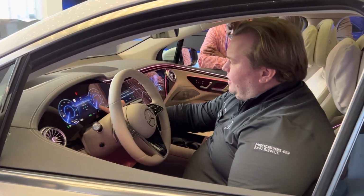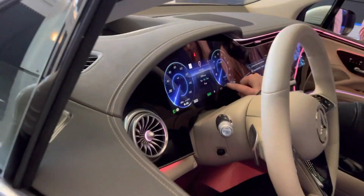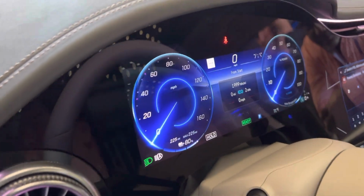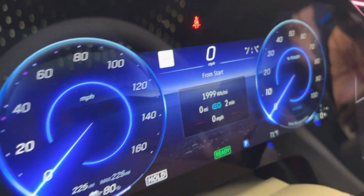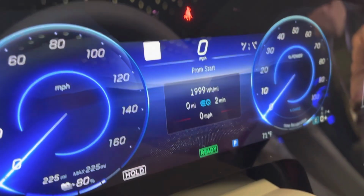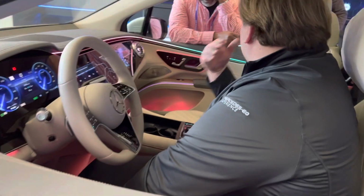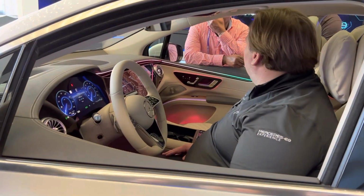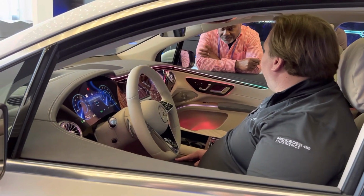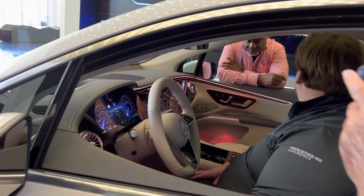I did want to mention that this really small bar at the top will show you how much charge is coming back to your battery. Whenever you let off the accelerator, it will highlight, and then it'll go back down. What's the benefit of being in D? Nothing, just like I said, more control. If you don't really like recuperation mode, maybe you don't want to feel the give and take, and you're on the interstate and you just want to drive, that's up to you.